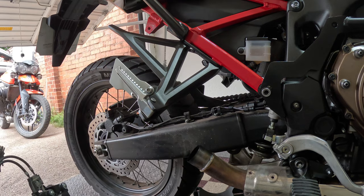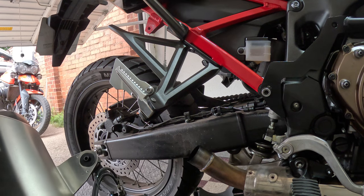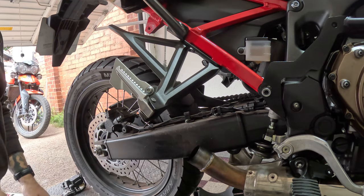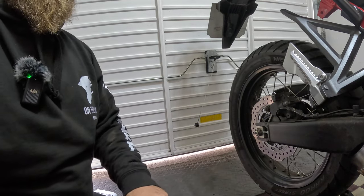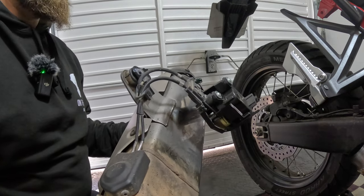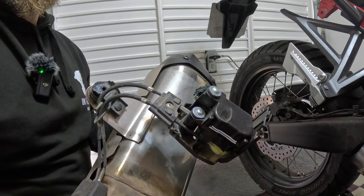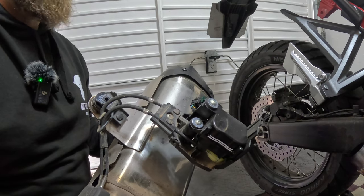She's a heavy old beast — we don't need that anymore. Take this whole unit and store it somewhere in your garage for the next five years, somewhere you can trip over it most days. There is the option of disconnecting the servo unit, taking these cables off the original exhaust, and reinstalling that servo unit back under the bike. But I've bought the servo eliminator kit — it's so much smaller and lighter. I'm just going to plug that in and be done with it. That's the easier option and what I would recommend.